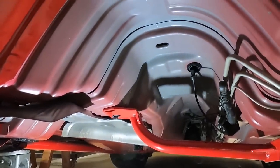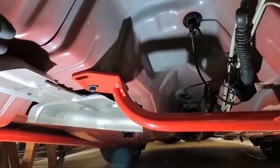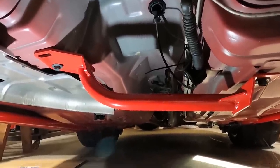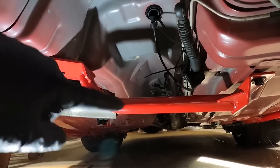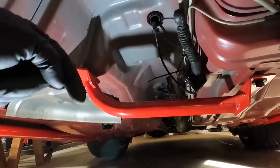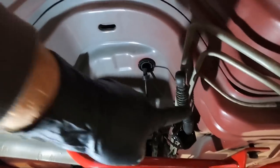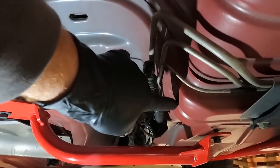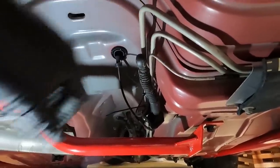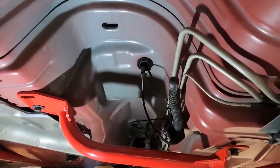Hopefully you can get a sense of how it's going to be in here. I've just got one bolt kind of loosely threaded in on both sides, but this is the way it faces. It can only go in one way, so you can't put it in backwards. Now let's go ahead and put the curved side on the transmission — put the mount on the tail shaft, and then put this on the end of the mount. We're looking for this area right here. This is generally where the clearance has to be — it is very, very close to the fuel lines and your factory fuel lines.